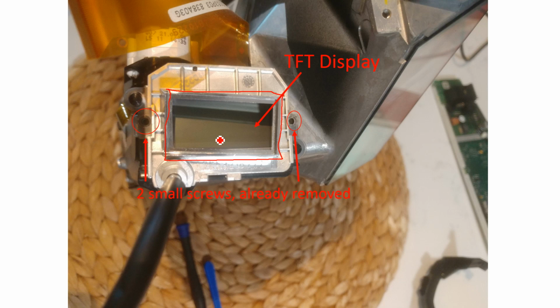The way the HUD works is it's a bit like the allegory of the cave, if you will. This thing here shows an image and it's sort of see-through a little bit. So you'll have whatever you want being displayed on here. It's not very bright, and then that LED matrix we were just discussing shines light onto the image, and where the light hits the image, you get contrast appearing, and that contrast then goes through the TFT display and reflects off the mirrors and gets enlarged, and then it is displayed on your windscreen. So it's pretty cool.